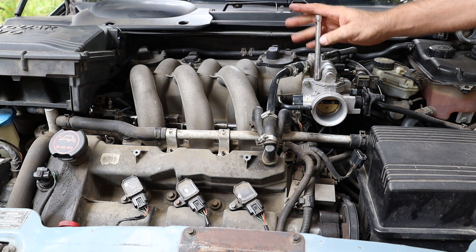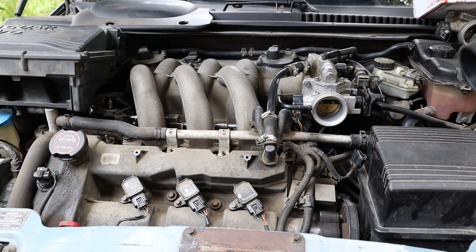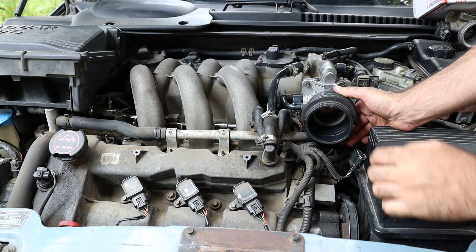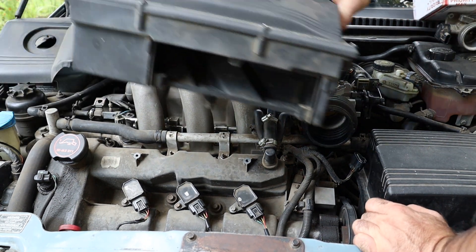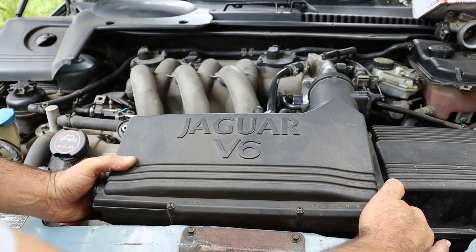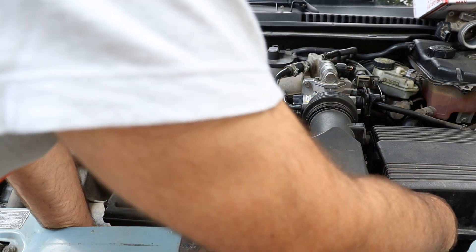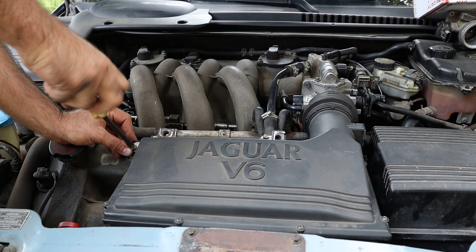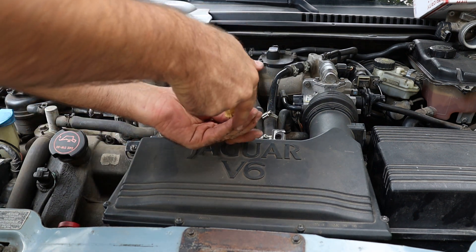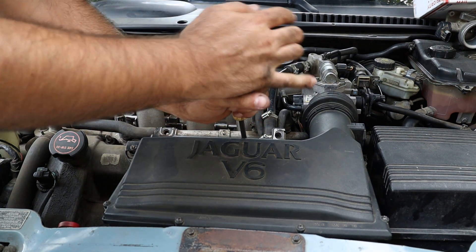I plugged in the idle air control valve connector and installed the PCV hose and the manifold to airbox hose. After that I put the airbox in its place. I don't secure the nozzles of the airbox with two inner screws when installing it — I won't have to take the airbox apart in the future when I'll surely have to remove it for repairs; I'll just remove it completely. I secured the airbox with a bracket and tightened two bolts — originally 6mm bolts, but I've made a notch on their heads so I can handle them with a screwdriver, which saves a lot of time.